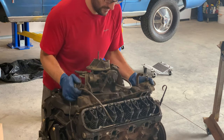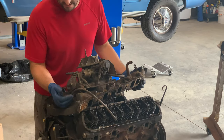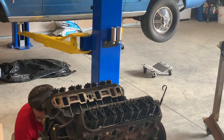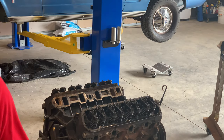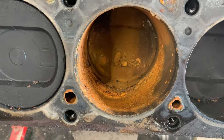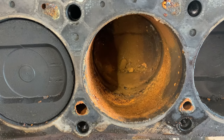To recap what we've been working on with the Thrift Horse: we got a 351 Windsor for free based off of a project that we bought another transmission for, for our 1953 Ford F100. The next thing to do was to naturally just tear it down and actually see what it needed. As you can see here, it's not the prettiest looking engine, and we did some more work to it, pulled stuff off to really find out it hydro-locked up, and two of the cylinders were really in bad shape.